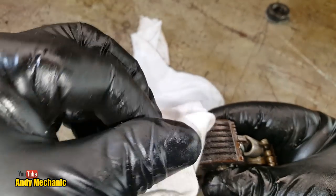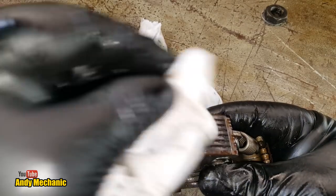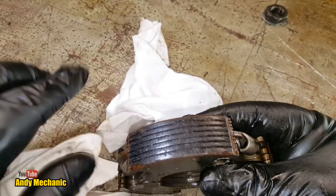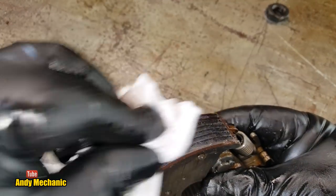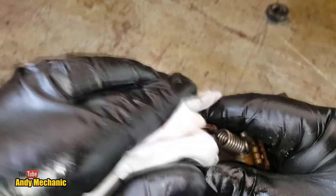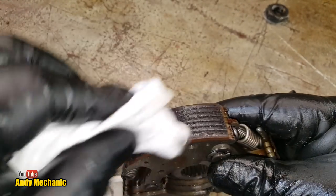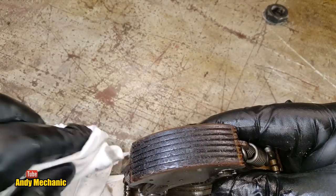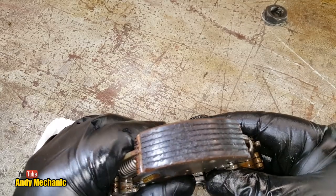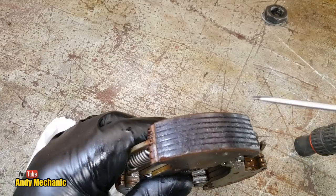One of the problems is if people top their engine oil up and use car engine oil. Now, car engine oil often has friction reducers in it. And things like this that rely on friction to work can really get affected by that, and unfortunately once it's in the material you can't get it out again. It's like a brake shoe, just like your brakes on your mountain bike. If you're cleaning your bike with CRC or WD-40 and you get some on the brake disc and it gets into the brake shoes, the guy at the bike shop is going to tell you need some new brake shoes.